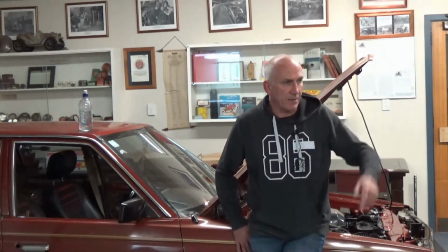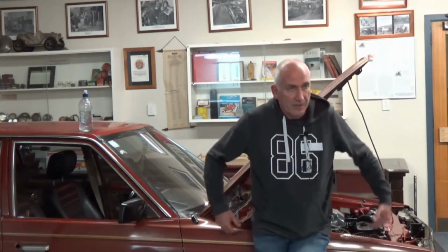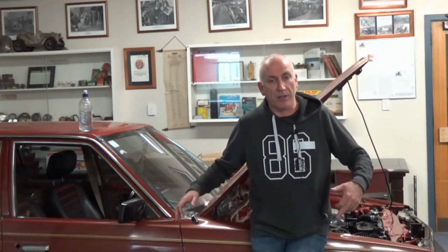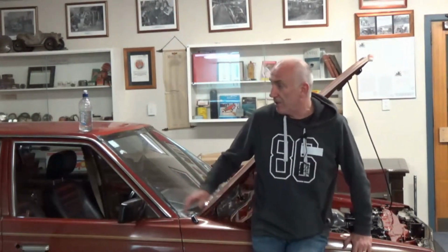If you recall in the magazine, probably two or three installments ago, I talked about a guy up Tauranga way who's got the model before this, the same basic floor pan. It's got the BEAMS motor with the quad throttle bodies and all that on it, nicely sourced, making 225 horsepower. He had a bunch of shocks he shortened because he does a bit of motorsport fabrication, and he went with some lowered springs, and then he went to adjustables. So I've got those shocks off them, which I will fit, and hopefully they'll retain. If not, I'll modify something so they do. Long story short.